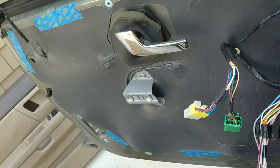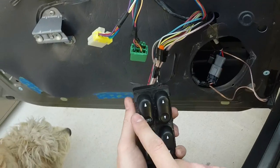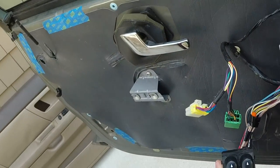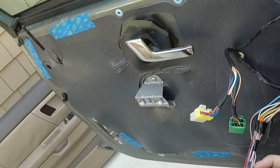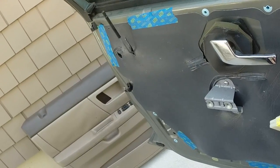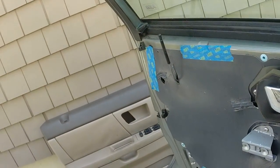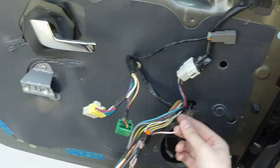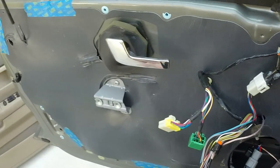The only thing that did was bypass the relay switch which is the one-touch auto-down driver switch — you can no longer just push this and have your window go down automatically. Your window on this side now only operates like a normal window. I don't think there's anything to complain about because your window now works, and you've spent zero dollars if you have extra wire — otherwise not even a foot of wire, which can't be more than two dollars.